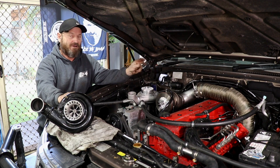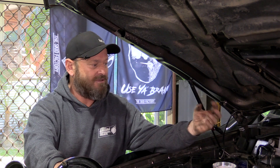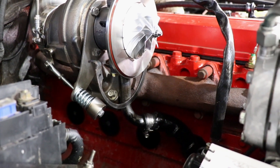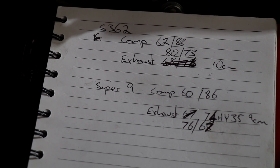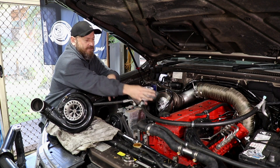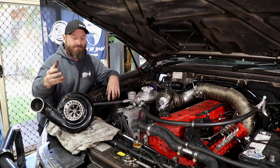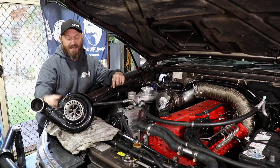I've already sort of fitted most of it up and started fabricating a few things. It is what they call an HX Super 9 — basically a bit of a parts bag of Holset parts, which is the original turbo manufacturer for Cummins stuff. It is an HX35 core with a HY35, which is a lot later model exhaust housing — nine centimetre housing. It's got a billet compressor and a 67 mil turbine. The big difference between these is not so much in the compressor side; they both have billet compressors. This one is two mil smaller in major and minor than that one. But the big difference is in the turbine — this one is about six mil larger.